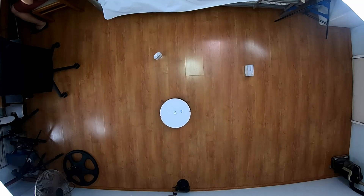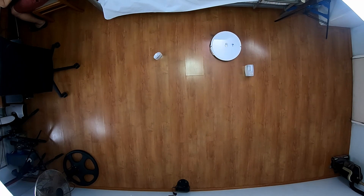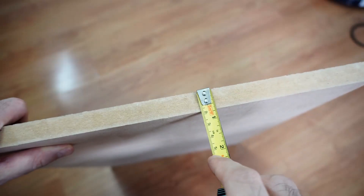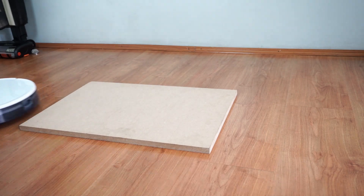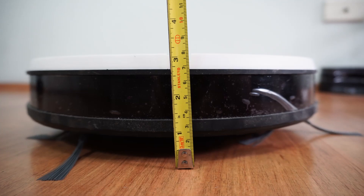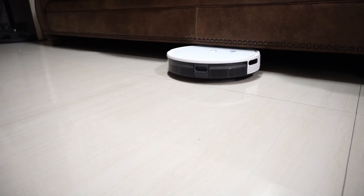It's also good at avoiding obstacles. In this overhead shot, you'll see that the alcohol dispenser and water bottle barely moved as the robot turned and avoided them when it detected these objects. It has good climbability, going over a rug measuring 0.8 inches tall. I also tested it on an MDF board measuring 0.7 inches thick, and it went over it without any issues. One advantage cheaper robot vacuums have over more expensive lidar-based robots is their lower profile design. This robot measures just a little over 3 inches tall, so it fits under our sofa with a 3.5-inch clearance, something not possible with any of the lidar-based robots I've tested so far.